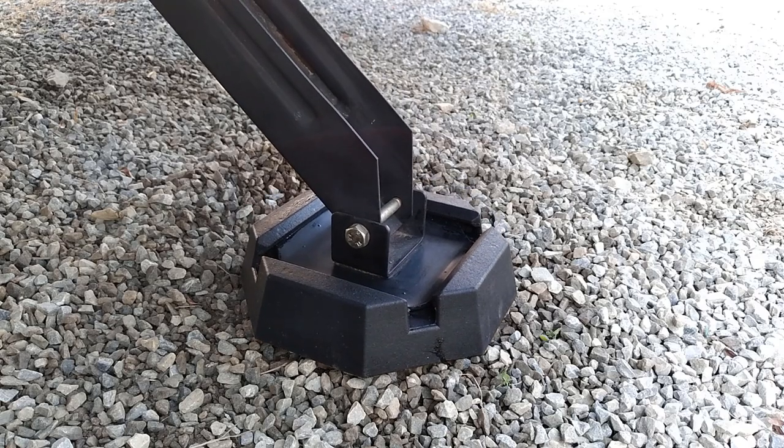Before you buy and before you click on that link, first you've got to watch this video all the way through, and second, before you start, we've got to measure your stabilizer jack feet. It is critical that you install the correct SnapPad on the proper stabilizer jack feet. Make sure you measure them properly. If your jack feet are too small, the SnapPad may fall off. If they're too large, you may crush the SnapPad, making it unserviceable. There are no real standards across the RV industry for stabilizer jack feet — they are not all created equal.